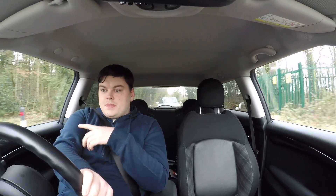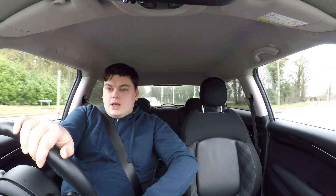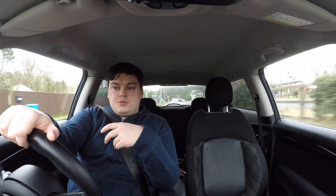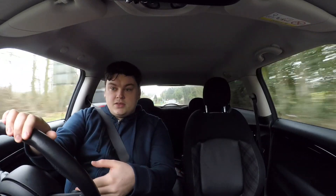I'm going to a location not too far away — just a long road that will allow me to get up to 60 miles an hour. It's a 60 road. We've got to do a series of 10 hard brake stops, which involves getting up to 60 miles an hour and then braking as firmly as we can back down to 10 miles an hour.